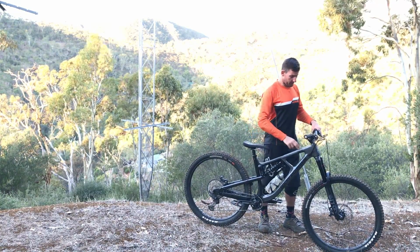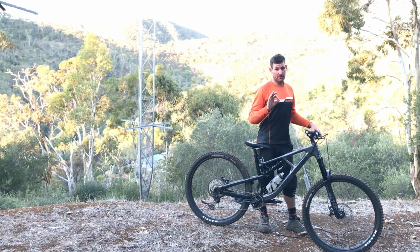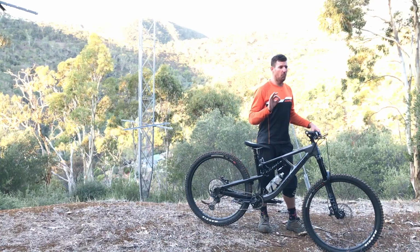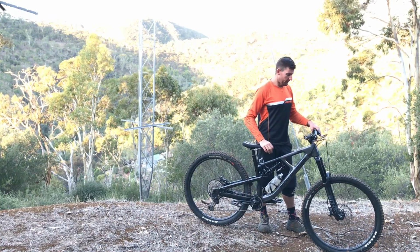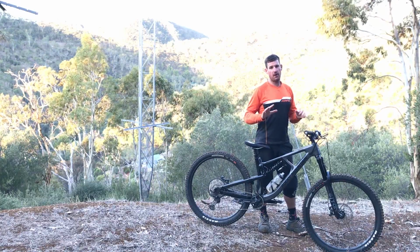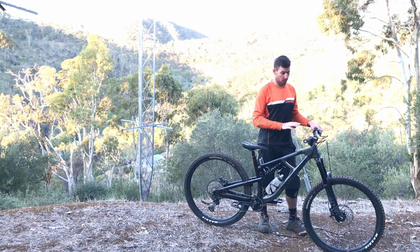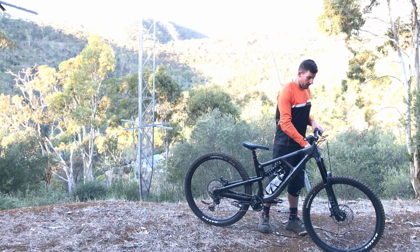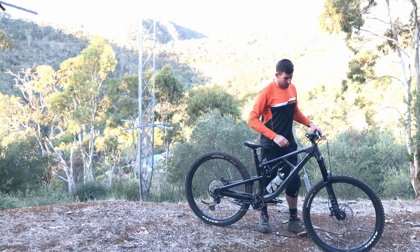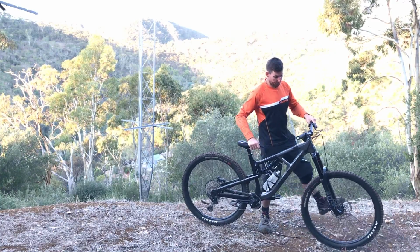Oh, it's killer. This one, 1 token, 15%. Feels really, really good. 1 token at 20% almost feels a little bit soft. So 2 tokens at 20%, really good. Ever so slightly starting to get into choppy territory, but still good. Really, really good. So I'd be happy either way to run them 1 token or 2 tokens. It's not really detrimental at that point.